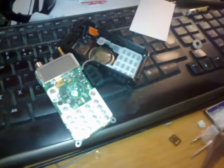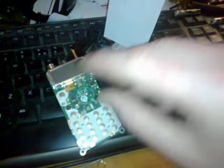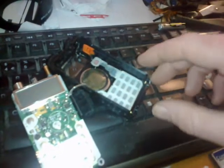There's not really any moving parts there, but the volume was scratchy and I can't turn it up and down smoothly. It gets used out and about quite a lot. So the little tip when you put it back together: get your bit of card, put it between the buttons and the case, slide it all back in — remember it goes in and then down so you don't snap anything off — then just pull the card up and it should all be lined up. Otherwise you'll screw it all back together and find your side buttons don't work.